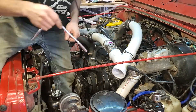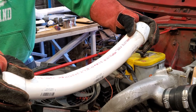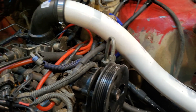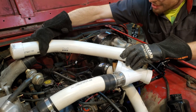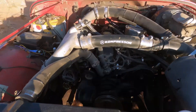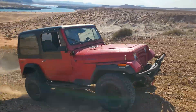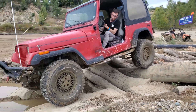The pros: it is low cost — I'll break down how we saved a lot of money using PVC in just a moment. You can bend it with heat, which is great because we can make custom bends with tools you already have in your house. The PVC pipe can hold up to the pressures and, for the most part, the temperatures it's going to see, and you can connect it to things and run air through it.